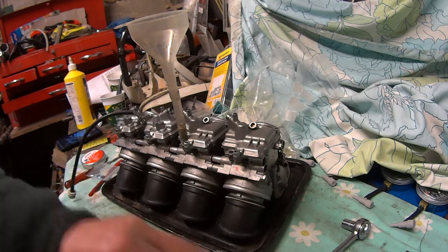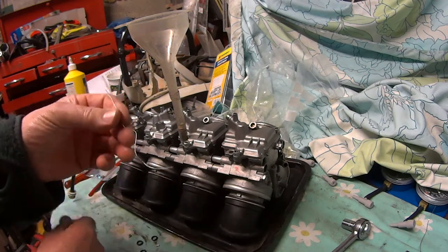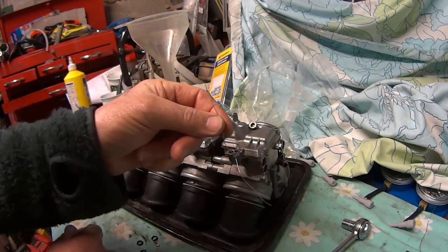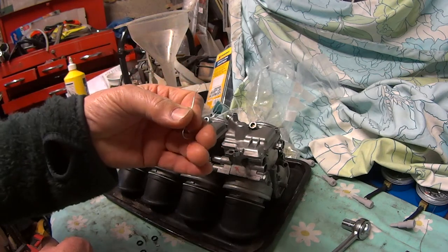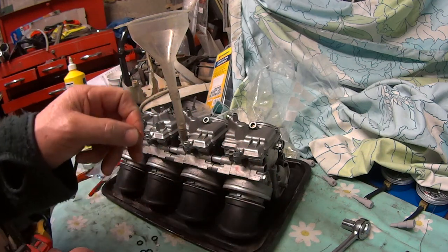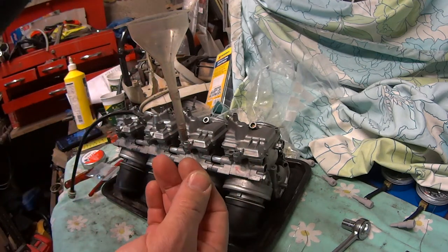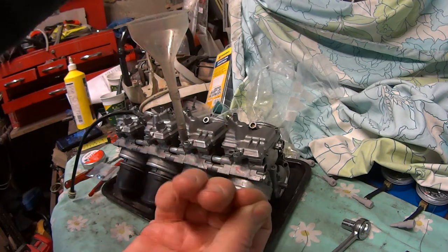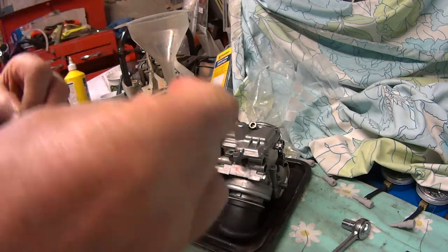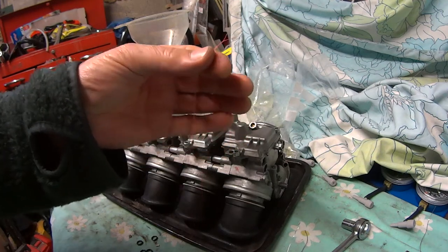So that was good. The other thing I might just add is that while the wire's good for holding the springs, if you don't want them to fly out, just poke a bit of wire through a couple of the rings on the spring and fold it, so you've got something that will hold the spring in case it flies out when you're moving them about. The best way I found, I've changed from holding it with a wire, is a piece of unbreakable thread here, which is really strong stuff. I can't break it with my hands, and it's thin, so you can tie a knot on the spring and just leave that hanging. If something does go flying, you're going to find it, it's not going to go far, it's going to be on that still.